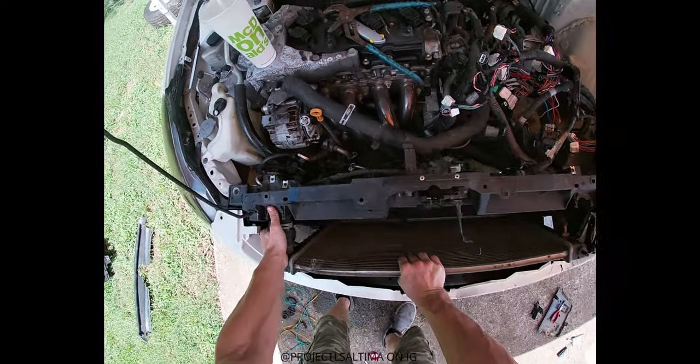The reason I went with 350z is because the axles can hold up to the torque and I can get aftermarket support for this. This is also all aluminum so it's really lightweight. From the driveshaft up, I've got to measure the engine and trans together — that means I've gotta get the Collins adapter and figure out the lengths. Then I can figure out where the engine is going to be placed, cut the front firewall, make room for that, make bellhousing room, and the trans tunnel. It's a lot, but it's a quick process.